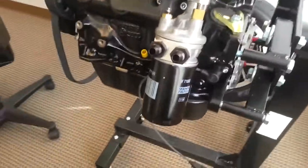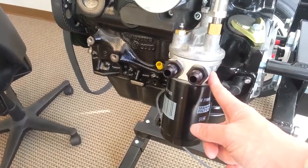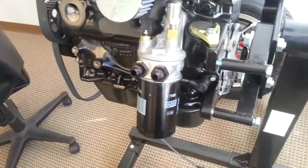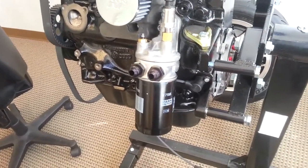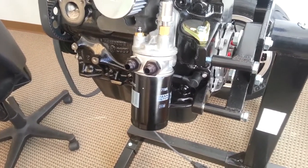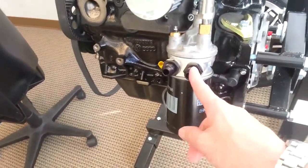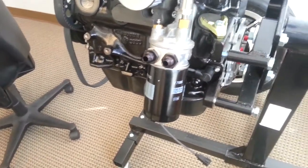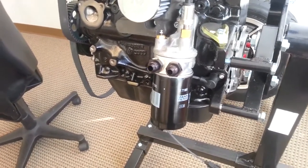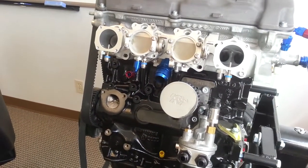There's my new MoCal British oil cooler — it's a high-temperature one, 200-degree Fahrenheit. A lot of guys run 180-degree thermostats, which is stock, but that's actually a little cold. Engines like to be warmer; the oil needs to get hot enough to evaporate any moisture that gets into the crankcase. So this allows the oil to reach 200°F before going to the external cooler, which will be integrated into my custom radiator — so the radiator serves two functions, both coolant and oil cooling.